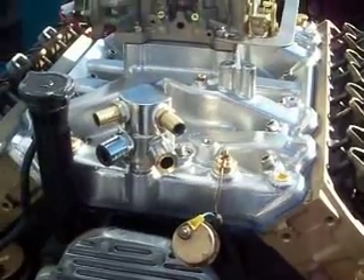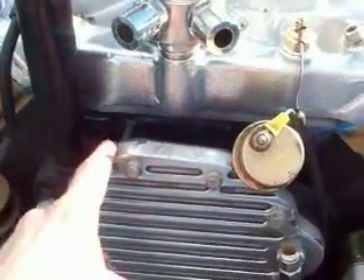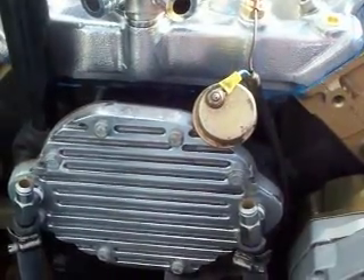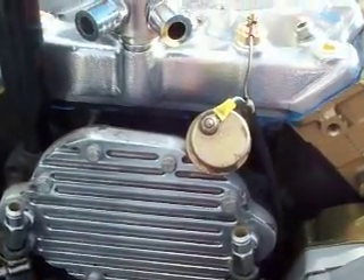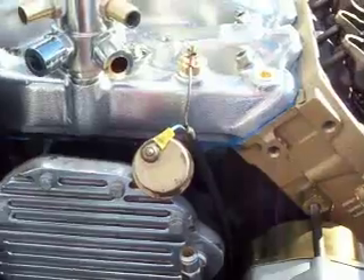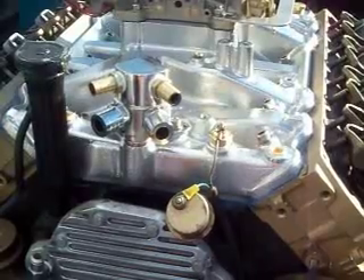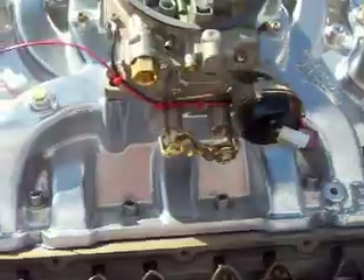The other deal is the intake manifold is on there — it went on pretty nicely. They did recommend that you just put a bead of silicone through here, but the thing was sitting up. There was a quarter inch gap, so it just wasn't happening, so I had to put a bead of silicone underneath it. Luckily I had the chunk of rubber strips from the gasket sets, although I did not put the turkey pan in — it was just a little bit beyond my technology to handle that today. Since the thing is jet-hot coated, I figured it's not as susceptible to oil migration porosity through everything. It's really nicely sealed up and it actually worked out pretty good.